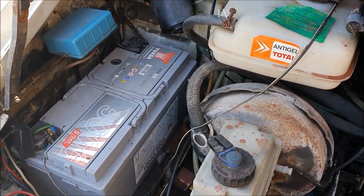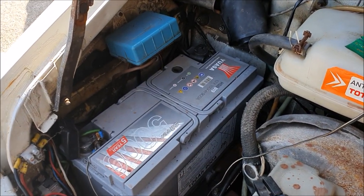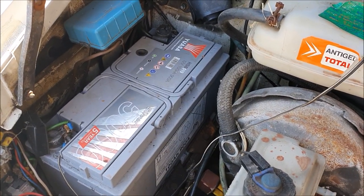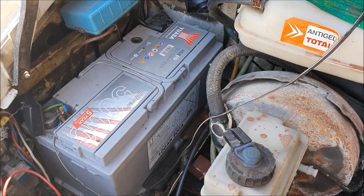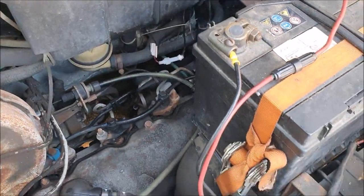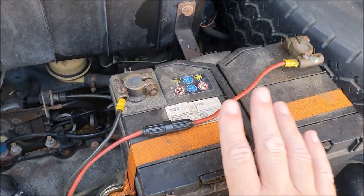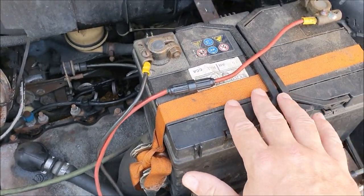When we bought the van there was no leisure battery at all - just the vehicle battery, which was a much smaller one. I've had to replace that twice; we had an issue with the alternator overcharging which boiled it up and ruined the previous battery. I've added a leisure battery - there's a metal cradle already here for it - and used the existing cables that were wound up around the front to connect it up. The fellow who sold us the van suggested he only used the vehicle battery to run accessories for camping, but that seems less than ideal.